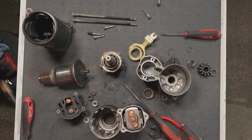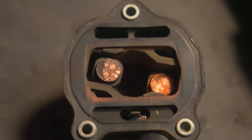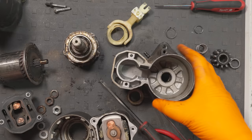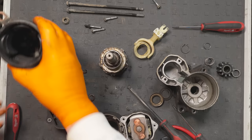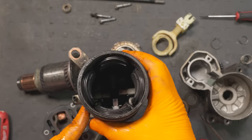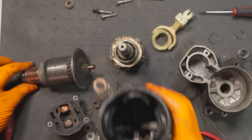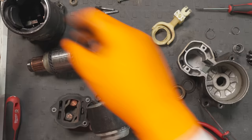So now looking at the result, you can see that our contactors have lots of points where they've been arcing and a lot of soot around there, but not as much corrosion as I was expecting. But also, if you look, they've got the drain or the little air vent there, and you've also got the air vent at this end as well. And you can see that that isn't really going anywhere into those brushes, and the brushes go onto this motor here, and of course that's going to be cleaning all the time, so I'm pretty sure there's no bad connection down there. And even though this connection looks like it's seen some work, it's obviously been on the car a long, long time, so I don't think that was a problem either.